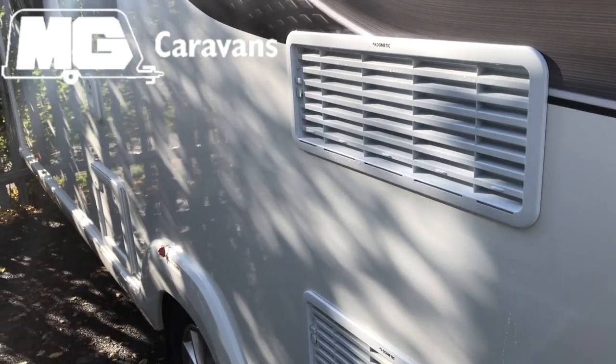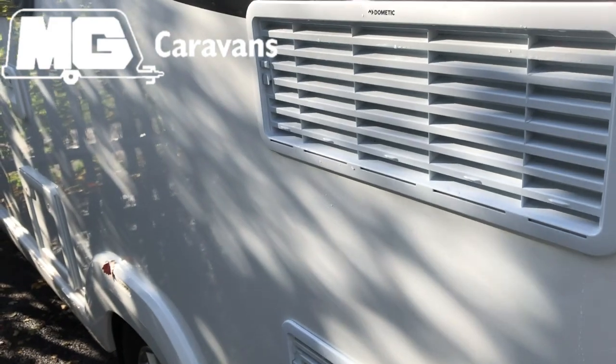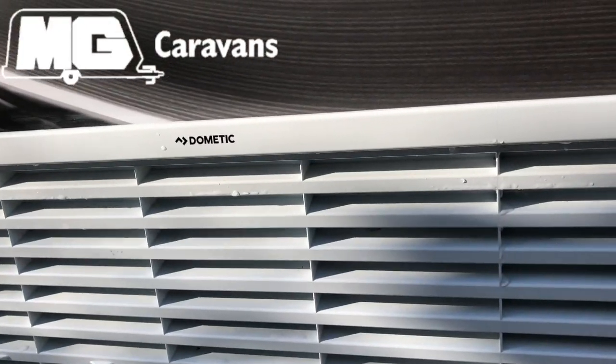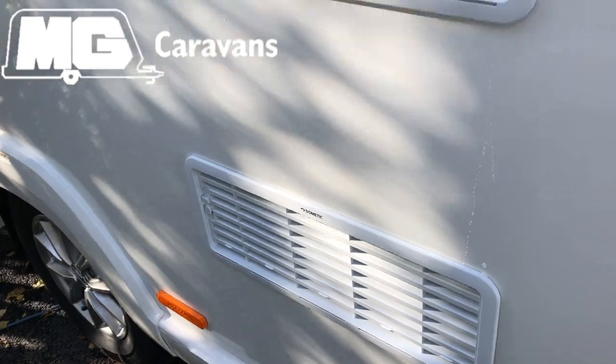When possible, it's a great idea to get a pair of fridge vent covers that look like this, dependent on the size of fridge vents you've got. These pop onto the vents, cover them up and prevent any leaves and debris getting stuck in your fridge vent, keeps it nice and clean.